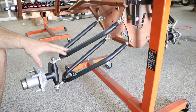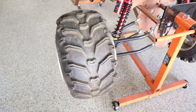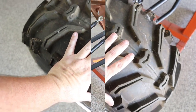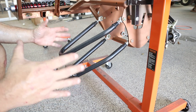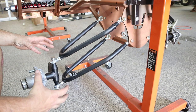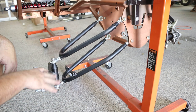On a side note, the wheels and tires we're going to be running are a set of 12-inch tall by 14-inch wide aluminum rear wheels mounted with a 25-inch bear claw. A lot of people either love this look or dislike it. I'm running them because of weight — those wheels and tires are extremely light, and they seem to act a lot better when you're doing wheelies. When you come down, because of the width of the wheel and tire, it gives you a much wider contact patch to land on and it doesn't seem to jar or hurt the cart as bad.